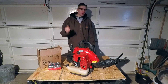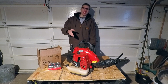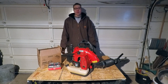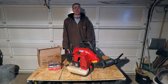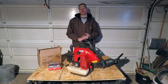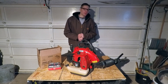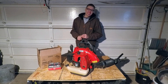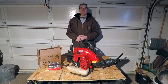Another thing to help keep your equipment running is to use 93 octane gas, or ethanol-free gas if you can find it — I know that's really expensive. We just use 93 because all the gas stations in our area do not offer ethanol-free, unfortunately. Ethanol is very hard on engines, and for the most part, if you have a small engine problem, that's why — it's because of the ethanol in the gas. If the ethanol was not in the gas, you would have no problem for the most part. I'm not an expert at this though, so I might have to have the experts weigh in on that.